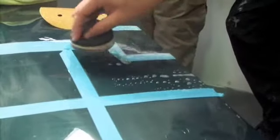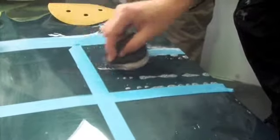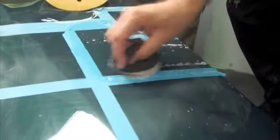How much would that normally remove? Again, it's down to the actual paint type that you're working on, but to give you a rough guide, when we were at the Northwest meet recently, Ian took a black Subaru wing for us all to practice on. With the Megs 105 and that purple wool pad, I managed to take 20 microns off in one set. With the wet sanding using 4000 grade, it took about 5 or 6 microns off in one set, and then we took the second set off and it went up to 10. So in 2 sets with the wet sanding, we'd taken half as much as I managed to do with the wool. Complete opposite to what anybody would think. And the point of the exercise was to show people you can do damage with anything if you don't do it safely.